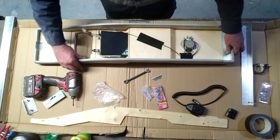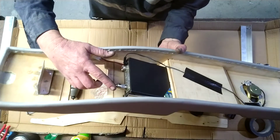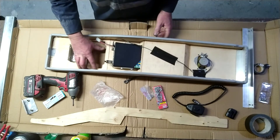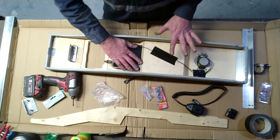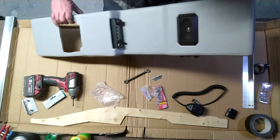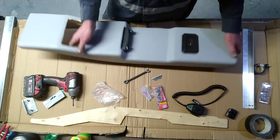Taking down all the cabling inside for the auxiliary speaker — when you put your plugs in, you want to keep the cable as flush as you can so it's going to be coming out directly that way, above the factory interior light. There's plenty of room there for cable to go around. I'm running two antennas for this radio — the AM which is the old 27 megahertz, and a 40-channel UHF. It's an older model, they don't make these anymore, but it's a fantastic radio — a digital version of the crystal set they released as analog style radios on the 27 megahertz.